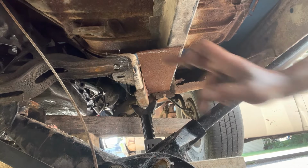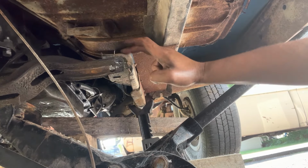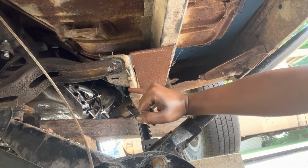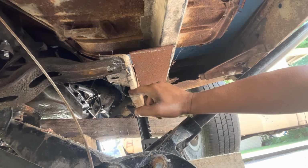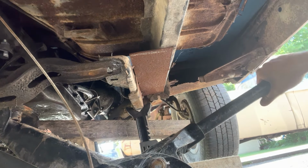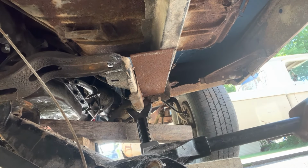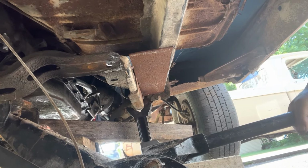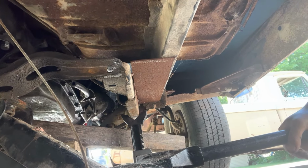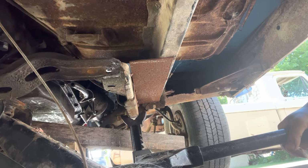As it sits right now, we're going to try and cut these little tabs off of here and get this set up where I can just drop a straight piece of angle iron in here. If I need to channel a little bit off the angle iron to fit and clear this frame rail. Might get a little goofy on the bolts because I know it's not perfectly spaced. If I crank this all the way up, I hit the tunnel before this completely bottoms out on that subframe section. And I don't want the trans sitting that high. I think it's pretty close to wanting to be that high, just not maxed out. You start cutting some parts off of this, and you guys can yell at me later in the comments.